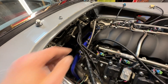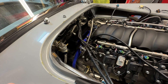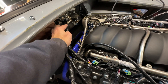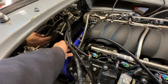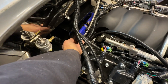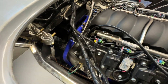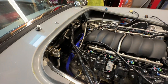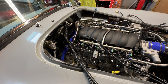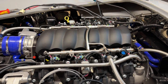It's not that pretty, but it actually looks a little bit more hidden than the previous loom which split off in a couple of directions right up here. I see what they're trying to do. We'll massively P-clip everything down here to keep it away from the engine. Anyway, first of all we need to find a home for that ECU.